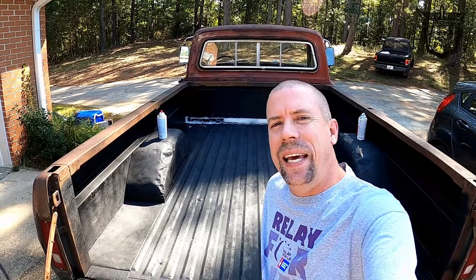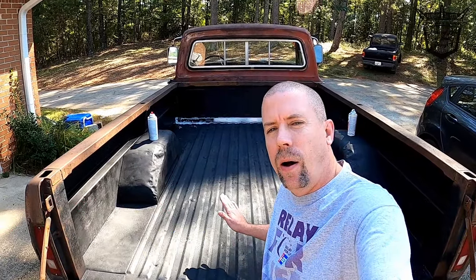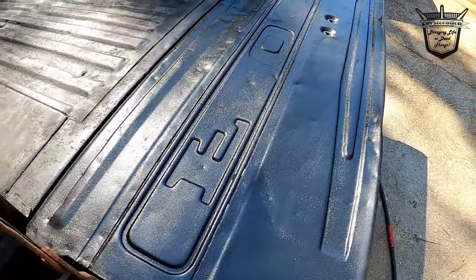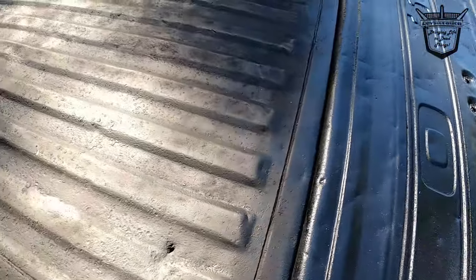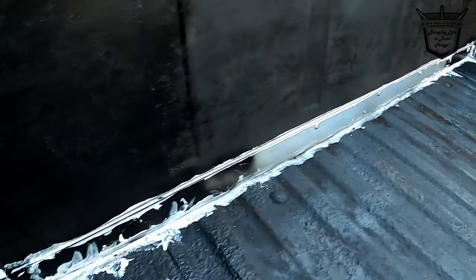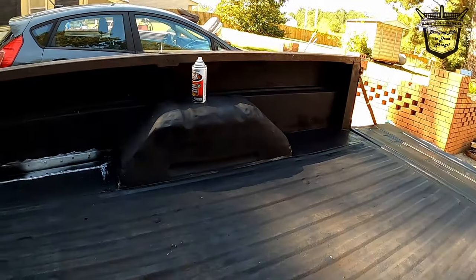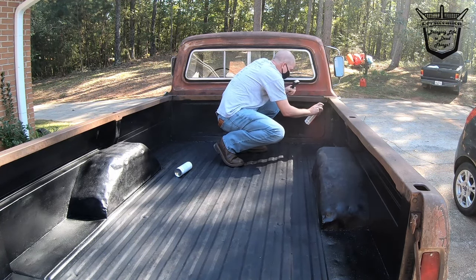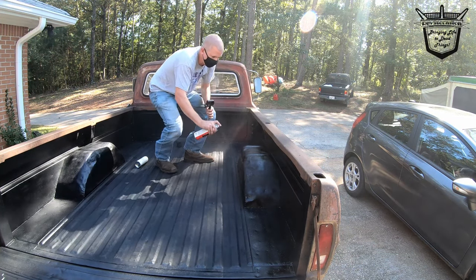We're back the next day. What I'm going to do now is put all the black paint — all the bed liner paint — on the truck bed. That's what it looks like there on the tailgate: really, really nice, got a little sparkle to it. I want to go transition into this and go all the way over. I've got the caulking done, everything is sealed all the way around. So I'm going to get it all painted and then come over the whole thing with the bed liner paint.